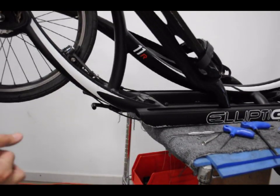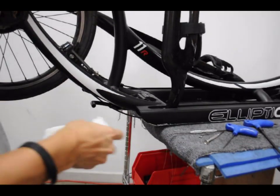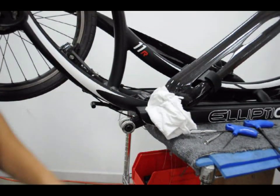Flip your drive arm over and place the rag between the drive arm and the track frame to protect the frame and the drive arm from damage. Slide the load wheels out the rear of the track.